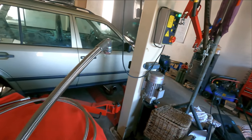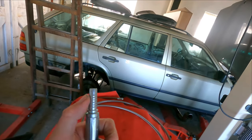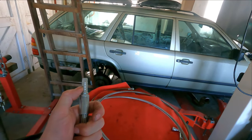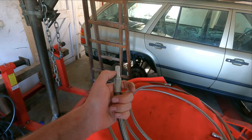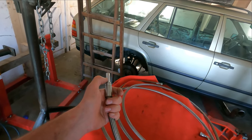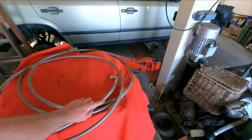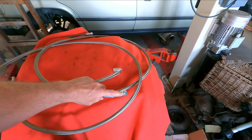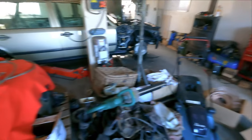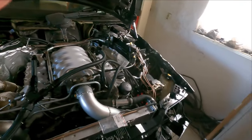This is the return line that will go to the fuel pressure regulator. I have here just a hose end - I can use the rubber end and go to the tank. Of course it would be nice to have it completely into the tank, but this is still a steel tank and it is very hard to get. I am not going to weld on it or install an AN8 connection. The feed line is on the ethanol sensor and the straight connection is just on the pump. I am going to install this and then show you the nice end result.